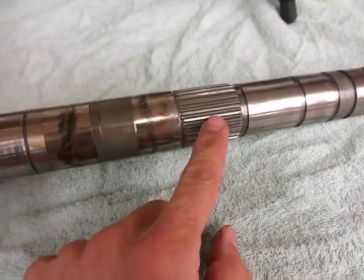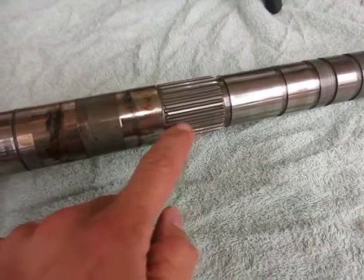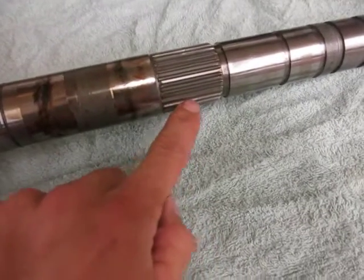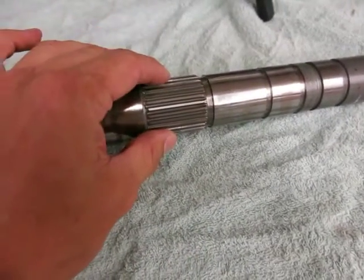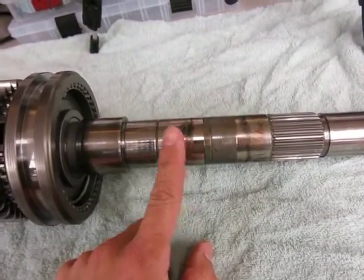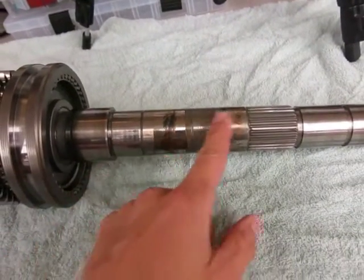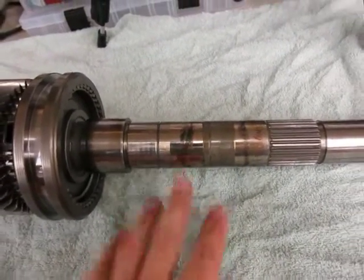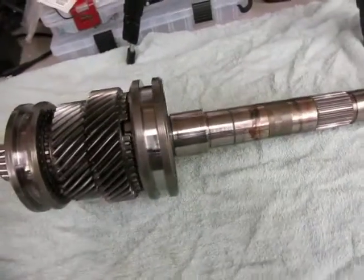If you look carefully at the splines on the main shaft, you can see a little mark where it was clearly wiggling and wearing, but there's virtually no physical wear there. I can barely feel a change as you transition from the noticeably shinier spots to the duller spots. So I don't think there's any wear to worry about here or with the gear, but I am going to have this fixed. There's a shop in Texas that can supposedly build this up and then machine it back down to spec, leaving it just a little prouder than factory spec so it's a nice tight fit and 5th-6th gear stays sound and balanced when you're driving.